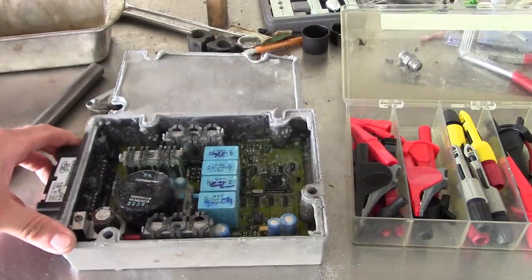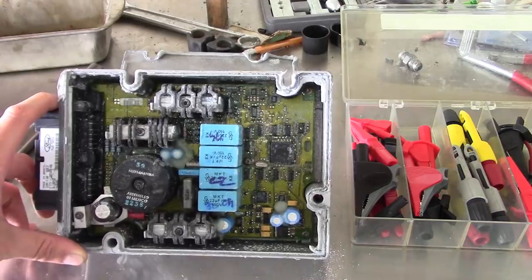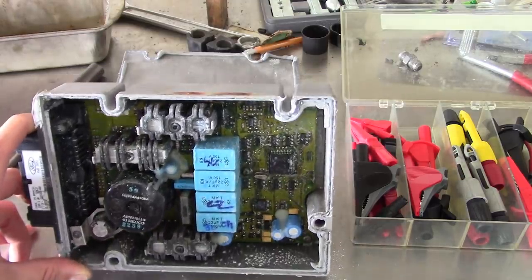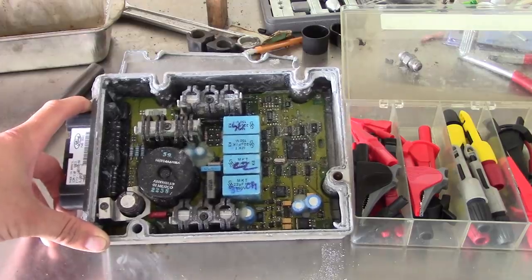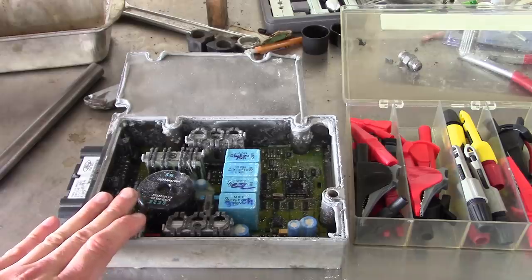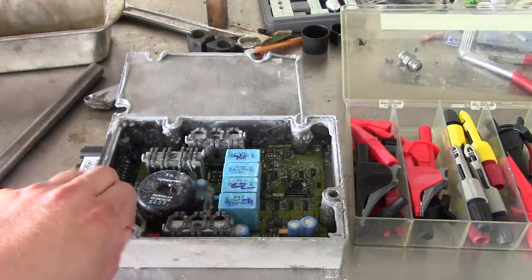I'm not sure about this old IDM either. Obviously it had water in it, but I think it may have been dead before the water got inside. There's no way that it would have gotten that much water inside within 25 miles, and two of them in a row. I don't see that. So I don't know if it can be fixed now. The board's conformally coated, so I guess there's a chance that it's still intact, but it's not good. I know it's frustrating that we don't have a definitive answer, but the truck starts, runs, drives. It's better than we had before, so I say we ship it out of here, move on to the next one, and if it comes back, it comes back.